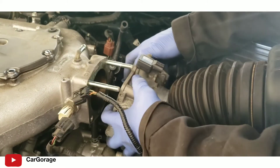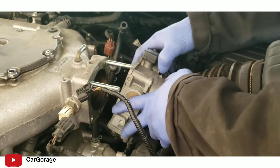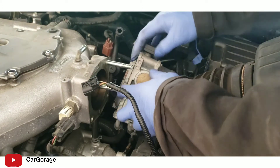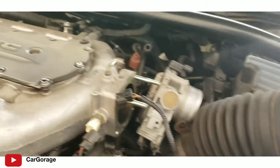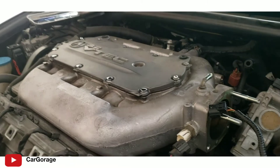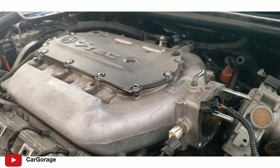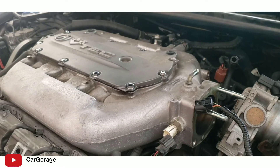There you go — I don't have to struggle much to make its way out even with the airbox air duct. It's out! Now we're gonna remove the cover for the plenum bolts, doing those 10mm bolts all around that cover in order to access the bolts for the plenum.